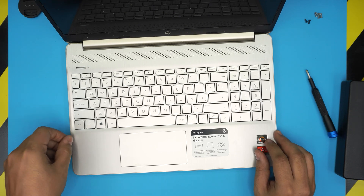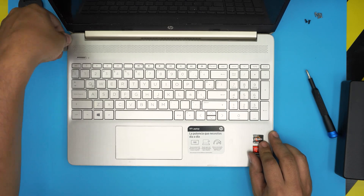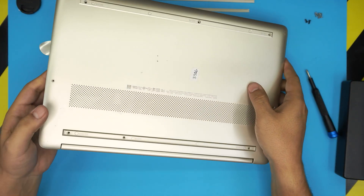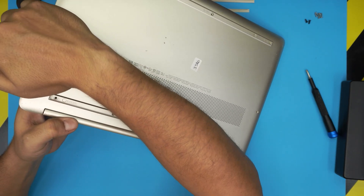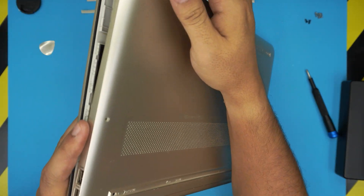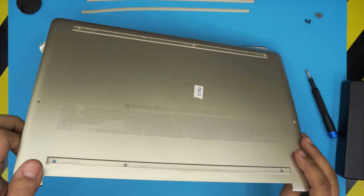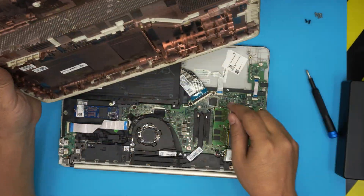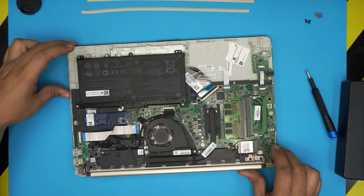Once you've gone all around, close the lid back up. Place your thumb right by the hinge under the screen, and with your fingers grab the top cover and peel it up a little bit. Wiggle it around and pull it up — there are a few clips in the middle where hooks are holding from the battery side. Once removed, everything is exposed.